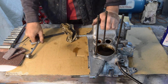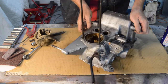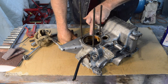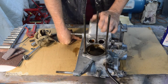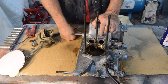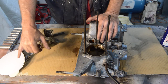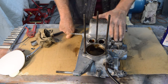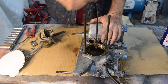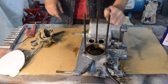So to do these again I'm going to re-wash the cases, because they'll need redoing once we've done all this work. The next thing is to check where your seals will sit and where your barrel will sit, because that's got to be clean. Now the obvious thing for this sort of job is to use abrasive paper, but if you use abrasive paper you've got to make sure that none of that grit stays in your engine. So the plan is we'll inspect this, clean everything up, and then it'll go back into the parts washer again.